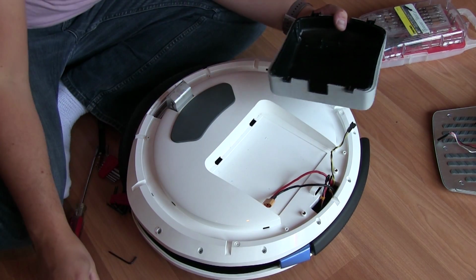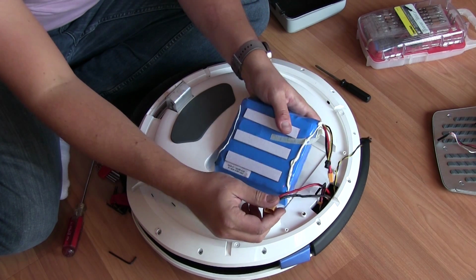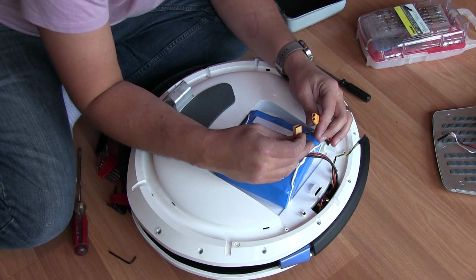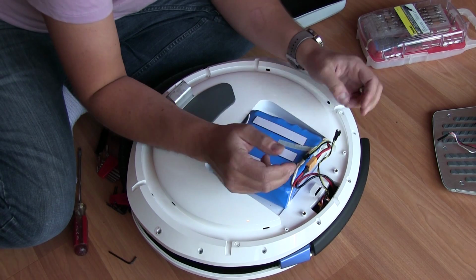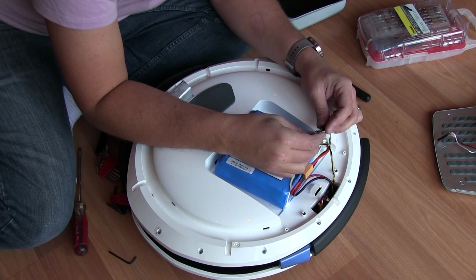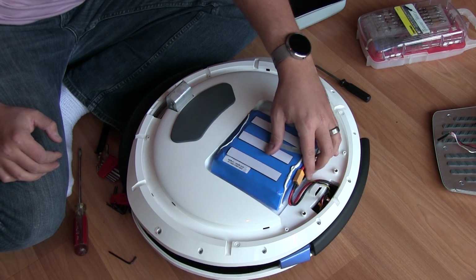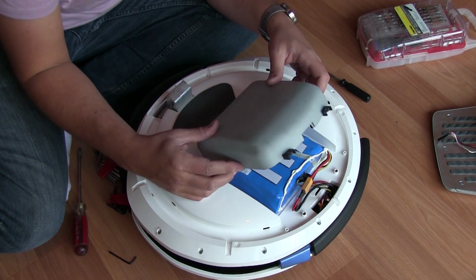Let's get the battery back together. Alright, so here's the battery. Quite heavy. 1 and 2. Now, this is where you want to pay close attention to those light ring cables. I'm just going to gently set them over here. Alright, these two connectors only go in one way. So we have 1, and we're looking at 2. And again, it only goes in one way. I just want to double check that my yellow lines up to yellow, my black lines up to black. I'm sure if you put enough force, you could force it to go that way. You don't want to force anything here.